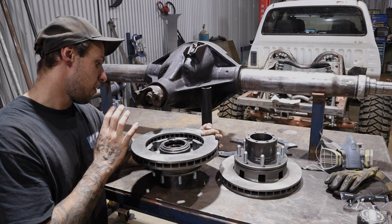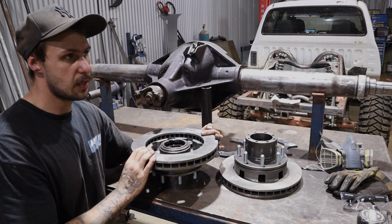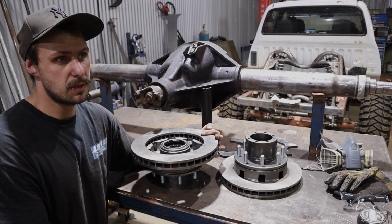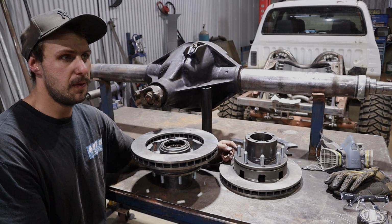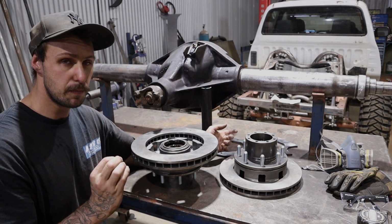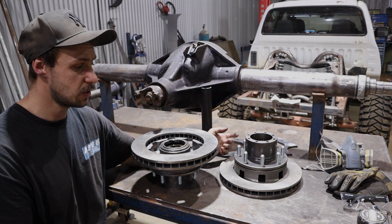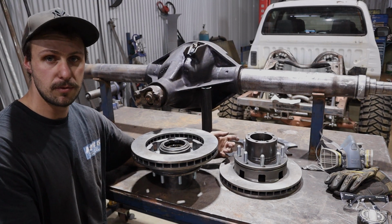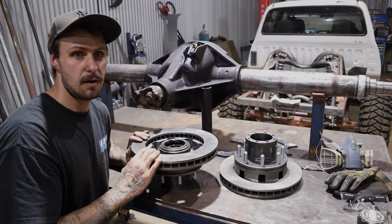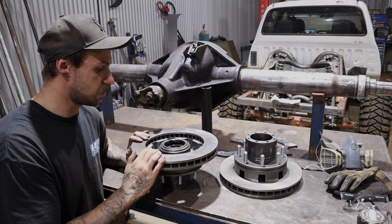Now, when I went to do this, I did some tolerance fits and checked it. It runs like an 11/16, which is something like 17.34 mil. So I took it to a 17.5 mil drill bit. Given the pricing of imperial drill bits compared to metric, with what we're doing on this, we don't need to be super tolerant, because we do have the keys below as it presses through the housing. That's something you don't want to touch. But yeah, a 17.5 mil drill bit, sent it through nice and slow, chipped it away. Cobalt is the key here. You don't want to be using cheap high speed drill bits and stuff like that. They will wear out real quick. So a nice cobalt drill bit, chuck that in the drill press, sent it through.